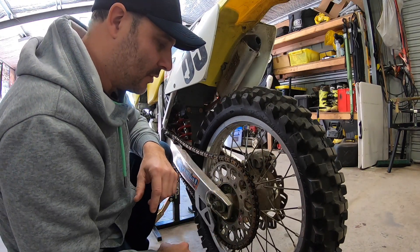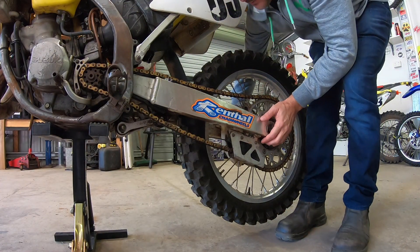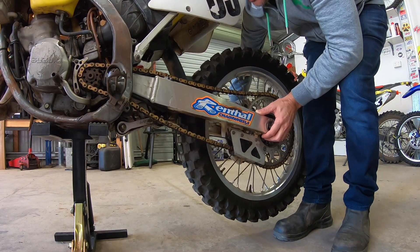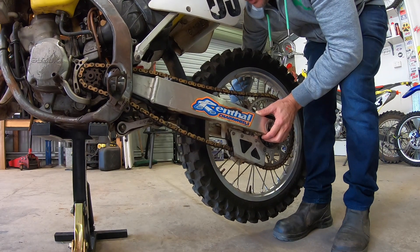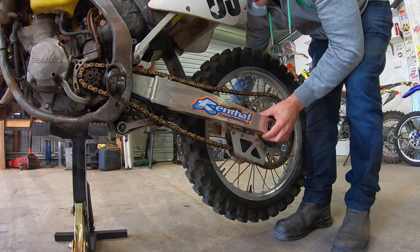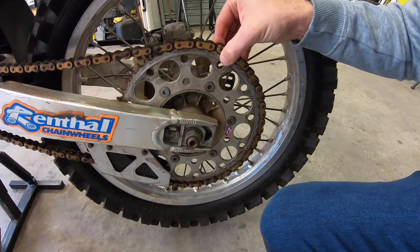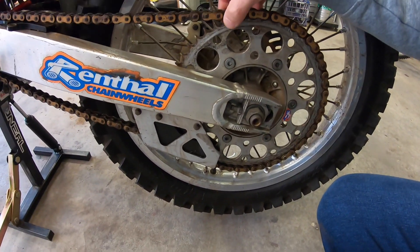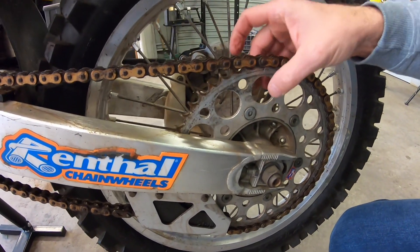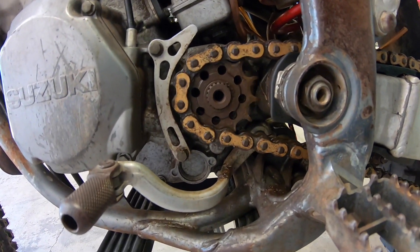This one here is actually quite good. While the back wheel is off the ground, I also check the swing arm for movement. This one has a small amount of movement — no side to side movement but up and down it does have a little, which could mean the bearings are gone. I then check the chain and sprockets for wear. This one seems to be about half worn — not completely shot, but definitely well used. The front sprocket has about the same amount of wear.